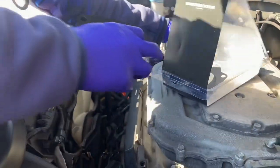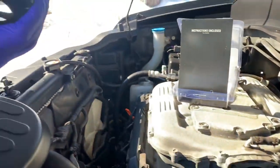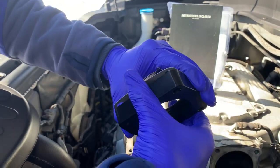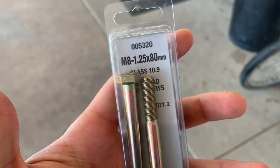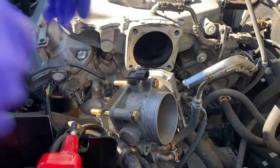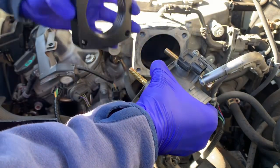Open up the packaging — you get two gaskets in this. Once you're done cleaning all this up, take one gasket just like that, make sure this side is going in there. If you guys are doing this install, you'll have to go to your local AutoZone and get M8 1.25 80mm bolts because the ones that come with the kit are too small. Get your new bolts just like this, get the throttle body and make sure this side is facing the throttle body like this.